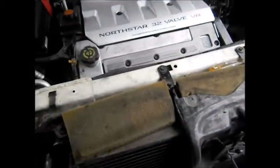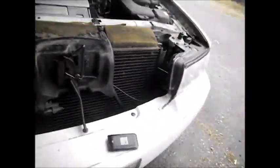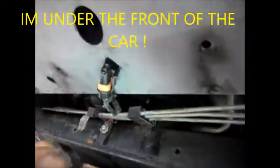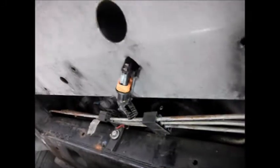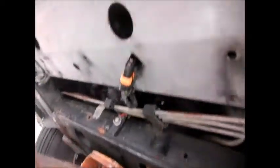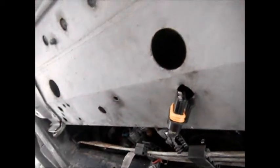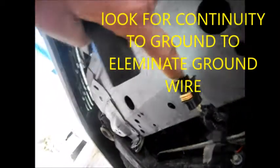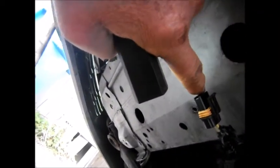What I'm going to do is put a manual switch for one of the fans. This is actually the fan wire right there. I was going to try and find the ground, because there's already one wire hooked up here and we don't need to duplicate it. There's a green wire and a yellow wire. I found this by taking a meter and checking which wire has continuity to ground. In this instance, the yellow wire is ground and the green wire is powered.